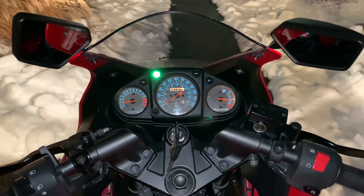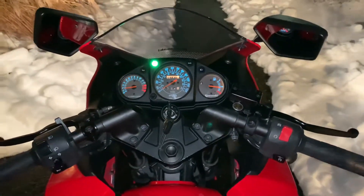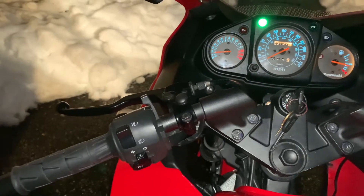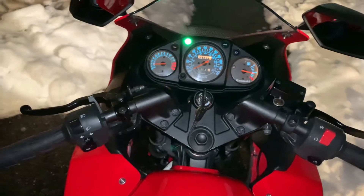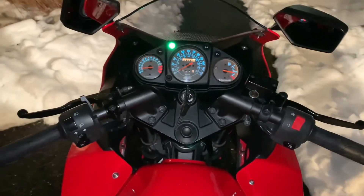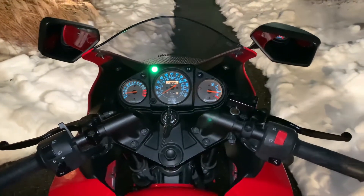I came back with the trickle charger and it started up right away. I had fresh gas — I just drained the old gas because I had a full can of Berryman B12, which is obviously too much to put in like full gallons of gas. So I drained it all out with the fresh gas. Another thing to mention: the choke — I barely have to activate it. I can put it at like 25% and the bike fires up, and I can shut it off right away and it won't stall out. The bike won't die. It's like the choke doesn't do anything. I verified the choke cable is working — it is opening the valve, I see it move. I just don't understand. Another thing I have to do is play with the idle screw. I usually turn it to the right so it increases the idle speed, and I use less choke, and that's what gets it going.